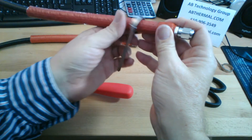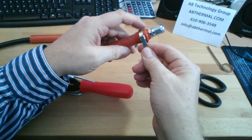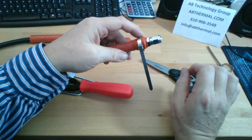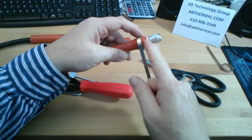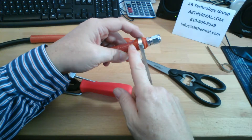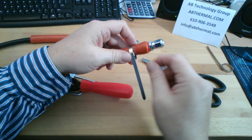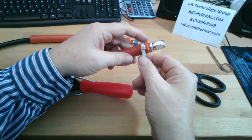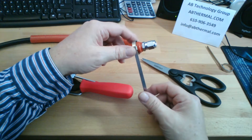Here's the twice around clamp. To be totally precise, you should measure the length of the back shell on the fitting to ensure that your clamp is holding the fire sleeve onto the back shell, and that it's not too far back where it's holding it onto the hose. To give it some extra purchase, some extra grip, try to get the fire sleeve onto the clamp area.